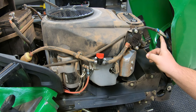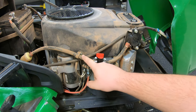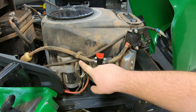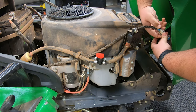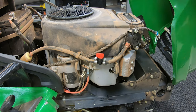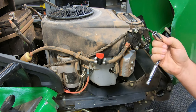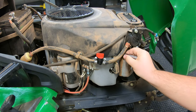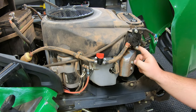We also want to undo our wiring harness to our lights because that is going to be connected to our fuel pump as well. One of our bolts that goes into our cover has our fuel line in it, so we're going to get that freed up and then loosen all of our bolts around the cover. First, we'll go ahead and remove our wiring harness — simply pull that up to free it. Then we're going to get our bracket off that's connected to our fuel pump, which uses a 10 millimeter bolt.